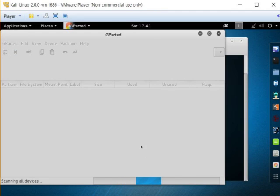And again, I'm not sure if I mentioned it, you have to use USB 1. I know it's on the side of the MXQ, so it might be kind of awkward always having a USB stick sticking out. Sadly, that's the only way it's going to work right now, unless somebody else mods the firmware. I tried putting it into the back, but U-boot just can't see that USB for some reason.